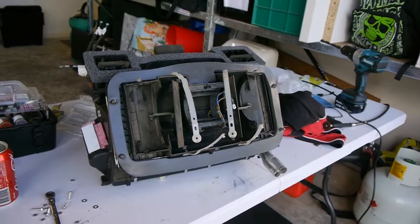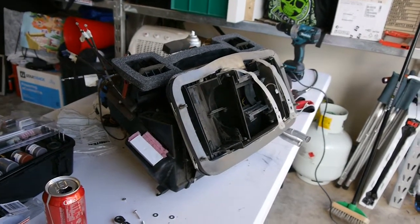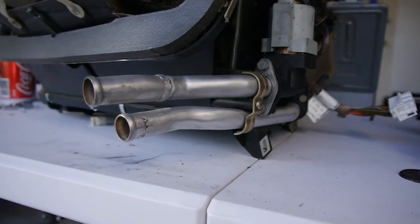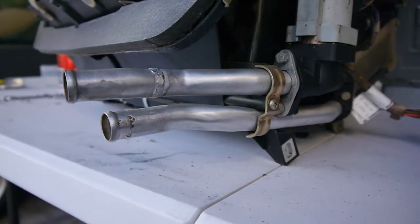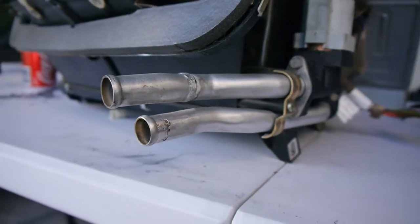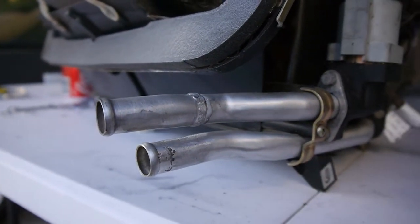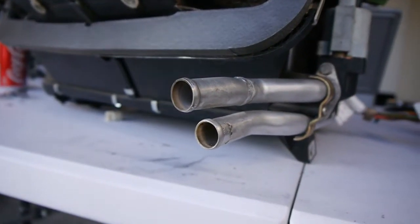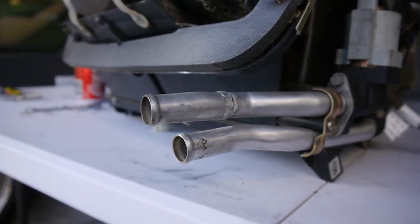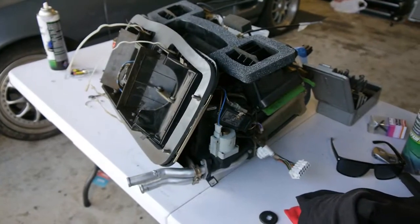The last major bit of work that's happened recently is to do with the heater core, the heater box, and the conversion of the aircon gases to R134a. One of the things I've done to the heater box here is modify the pipes that go through the firewall. From other conversions I've seen, this top pipe has a tendency to aim straight into the intake manifold of the M50/M52 engine. So I've sliced it and had a friend weld it back together — apparently quite difficult to weld being so thin — but now it aims off to the other side, giving more clearance to the intake manifold.